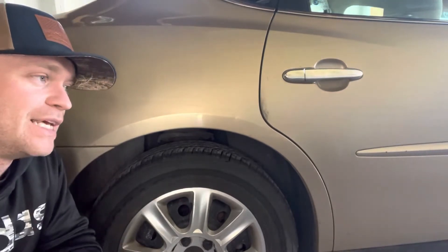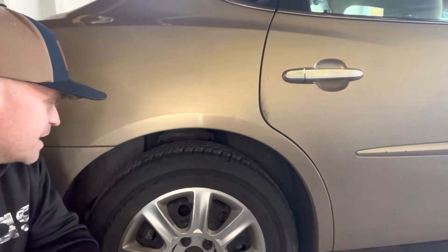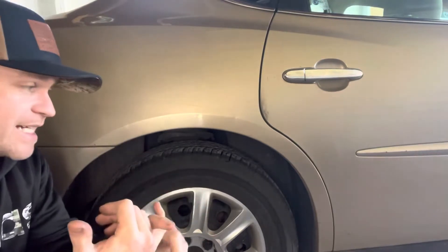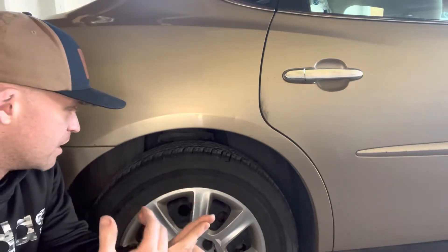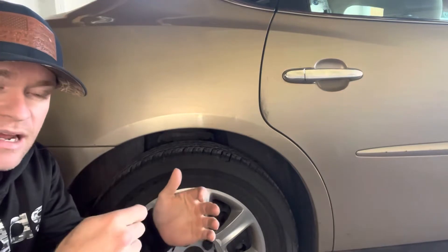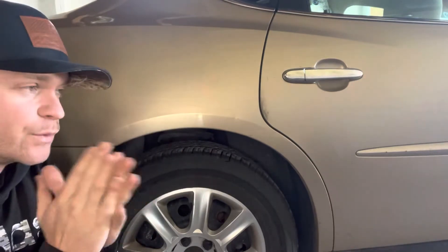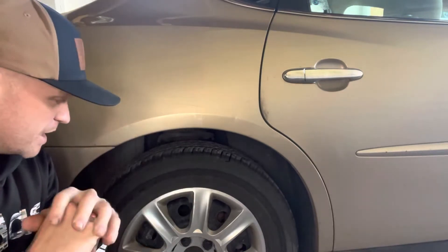My title for this video is probably going to be 'How to plug your tire in five minutes.' I'm going to grab my jack and tools and time myself for five minutes. All I'm going to need is a jack, a tire iron or impact gun to take the wheel off, some kind of pry tool to get the object out of the tire, a tire plug kit which you can get at Dollar General for a couple dollars, and probably a torque wrench. I would recommend torquing your wheels back down — if your wheel falls off your car after watching this video, that's on you.